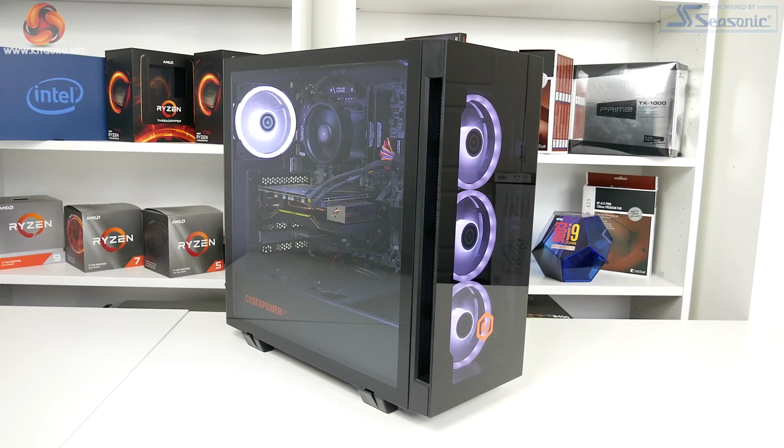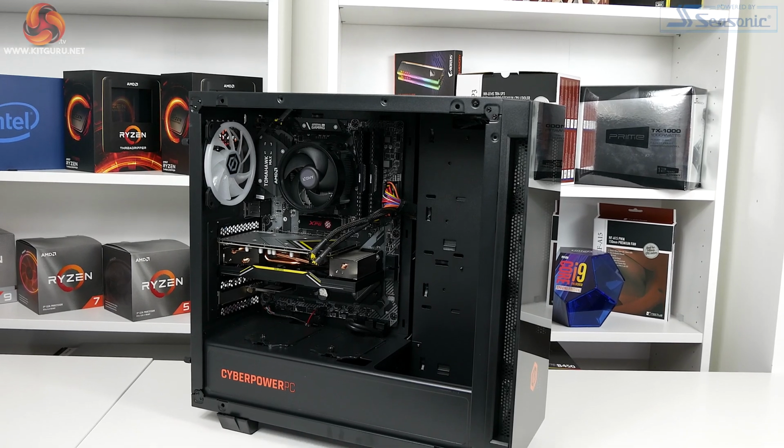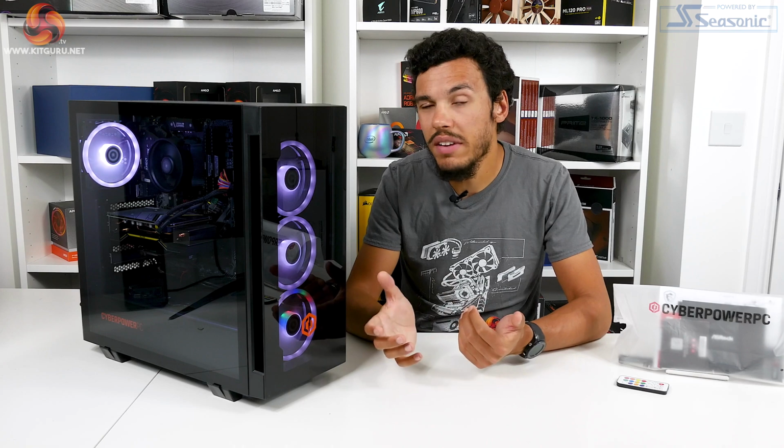I think the CPU cooler is perhaps borderline if you want to get full performance out of the Ryzen 3300X. We didn't really see any issues unless we were pumping out heat from the graphics card plus hitting the CPU really hard for sustained periods of time. And even then it would just reach 95 degrees Celsius and then clock down a little bit, because the Precision Boost algorithm from AMD is really, really smart. So you don't really have any concerns there. And it's not particularly loud overall.